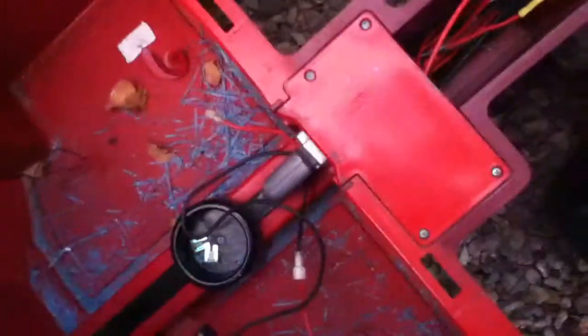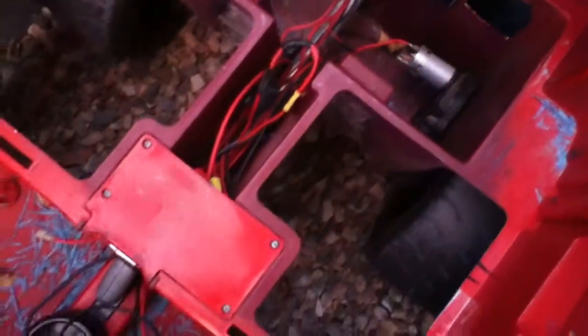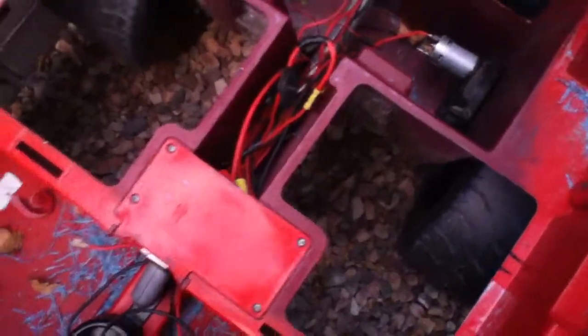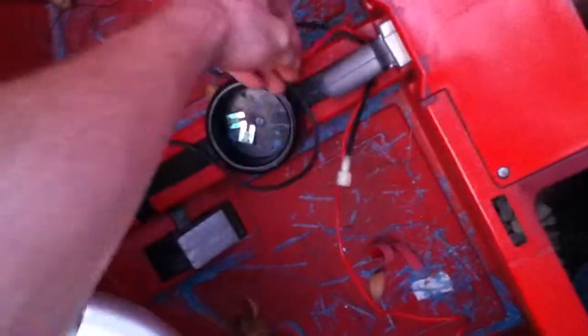All the wiring — basically all I did is completely redo the stock wiring harness to get the 24 volt to it. I redid it with 10 gauge wiring. They come with, I think, 14 gauge wiring, which can't exactly handle the 24 volts. So basically I completely redid it and then added in the jumper cable, which is these little short wires.